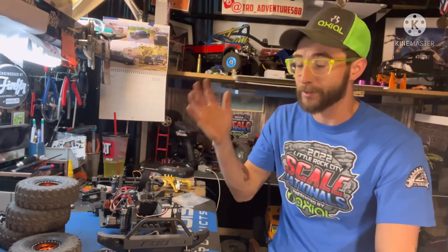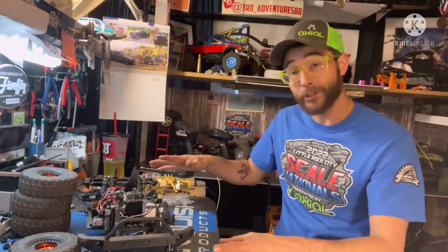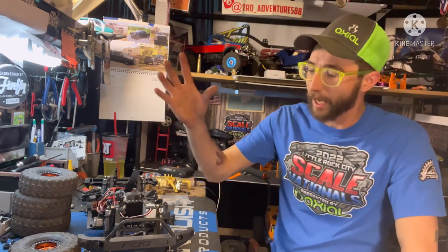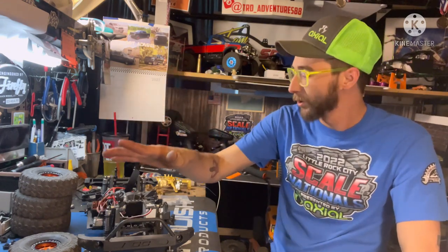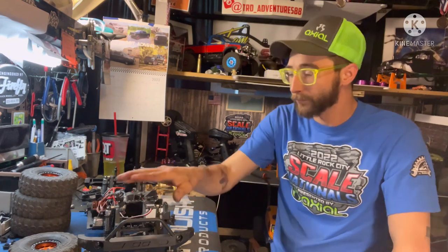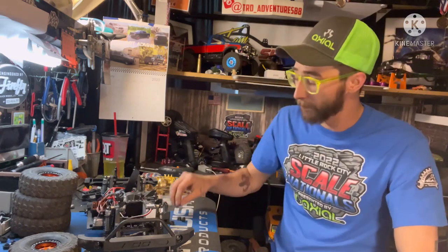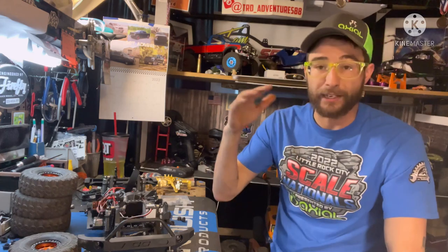The last part we're taking care of in this video is the shocks. I'm not mad at the shocks — I'm just going to try to get more out of them. I'll take all the shocks off, drain the oil, and put in new oil. I'm starting with probably 45 front and rear, or maybe 40/45. I'm also doing a mini-T spring mod using some In the Works RC spring cups and covers along with the Losi mini-T springs. I have a previous video walking through exactly how I do that mod.